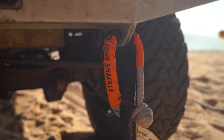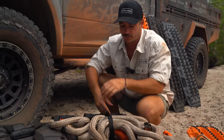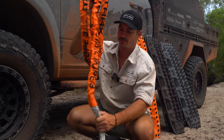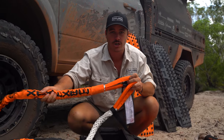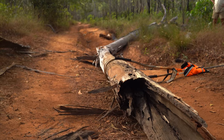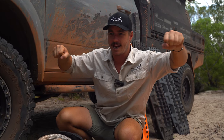When we use the MaxTrax recovery gear, we use it for a reason — everything here has been designed specifically around safety and strength. Your kinetic rope is the one you're going to use all the time — this is essentially what replaces your snatch strap. Ours is still a little bit wet and dirty because we've given this thing an absolute hiding on the cape, but this kinetic rope is our 10 metre. This rope will build and stretch, then come back together, and that's what's going to give you the pop out of your bogged position on the beach or out of that mud hole.